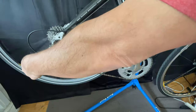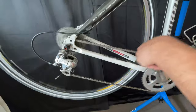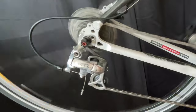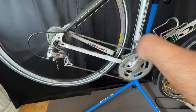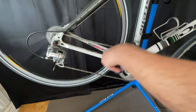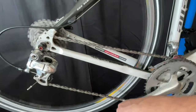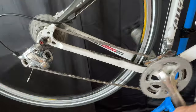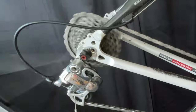That's what index shifting is — just fine tuning with the barrel adjuster so you get it perfect. You have to find that balance between too tight and too loose. Too tight means the chain won't drop on the cogs sharply and crisply, but too loose means it won't climb properly — just a little jangle. There we go. Just threw it into the small ring in the front to test it out. You shouldn't cross-chain, but it doesn't mean people aren't going to do it, so we just have to make sure it works okay.